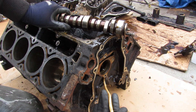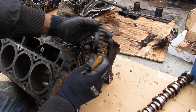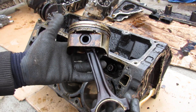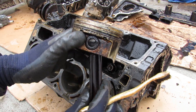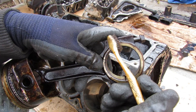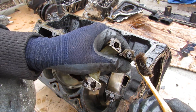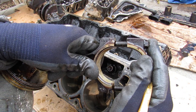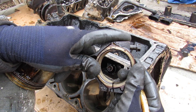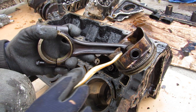The cam swap on these isn't too difficult — once you remove the timing cover and all the accessories, the camshaft just pulls right out. The LS engine uses a timing chain with sturdy gears and a chain that doesn't have a hydraulic tensioner that could fail. The piston is so sludged up it actually sticks at full swing. The connecting rods are a sintered powder metal design, meaning they were sintered as one piece then purposely cracked to form the connecting rod caps — that's why those edges are rough, not machine-finished. When installed, the crack locks together to prevent deformation. The aftermarket has also done a lot with pistons, offering different top designs and forged bottom ends.